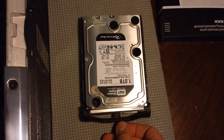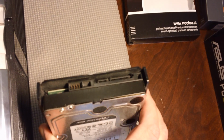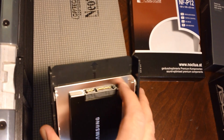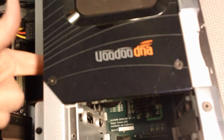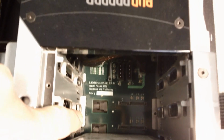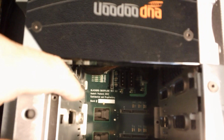These trays are really slick and work really, really well, but you can see the geometry of the mating is pretty precise, and on these drives it's on the right side with this bracket. It's kind of in the middle, so it doesn't line up. Now I'm sure a person could drill into this thing and make it work if they were more mechanically inclined than I am. But this works if you put it in this top tray, because there is a gap here, and you can directly run your SATA 6 cable and your power cable through that gap and bypass the back plate. So you can only do that, I think, with this top tray, unless you're going to do, again, some more engineering to bypass the back plate connection. But just something to keep in mind.